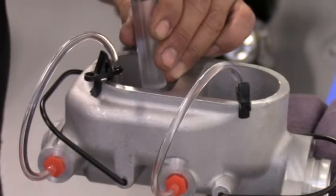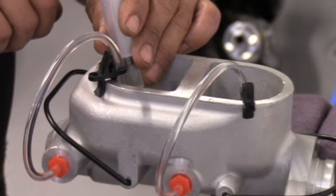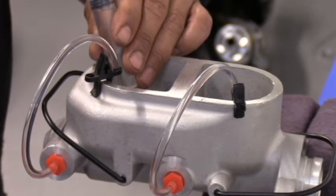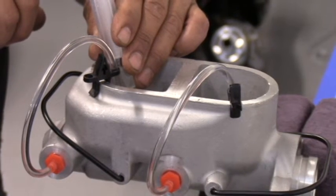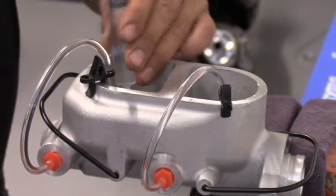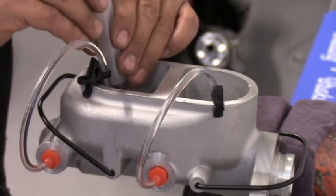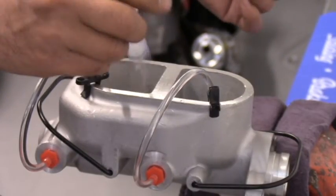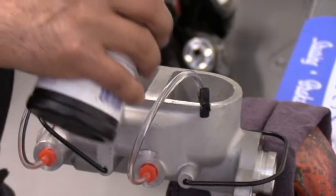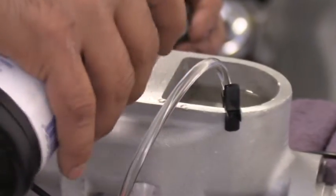Once you get to a good solid state, move to the front chamber. If you don't have our syringe — which is available with every order — you can do it the old school way by taking a screwdriver to the back of the piston and pushing it. But using the syringe really saves you a lot of time and effort, and makes sure to eliminate all the air with no chance for agitation of the fluid. It'll top off the chamber and you can pull the hoses or leave them in and carefully walk over to the vehicle and install it.